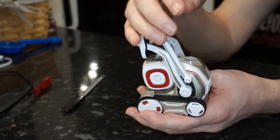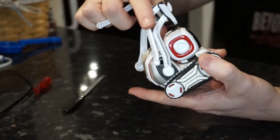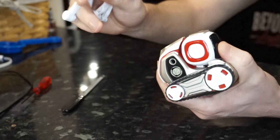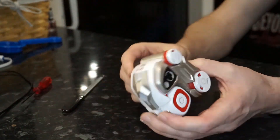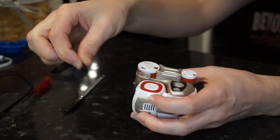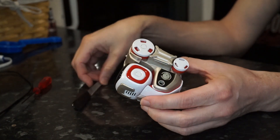You just keep the arms raised as high as you can, remove the post from the top, and then just pop them off — it's like suction-based on that right-hand side of the robot. That cog is what we want to get access to ultimately, because that's what we're going to be doing the repair on. Now stripping the tracks off the wheels — we're going to be removing three wheels.